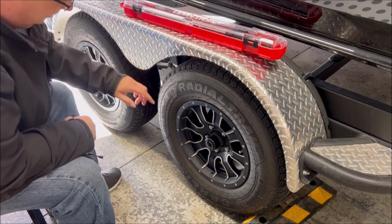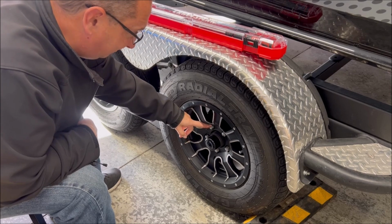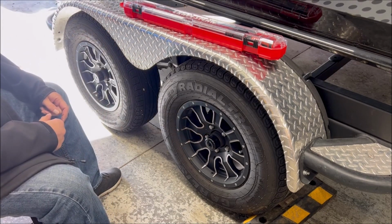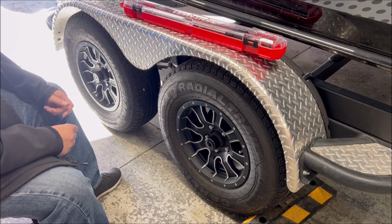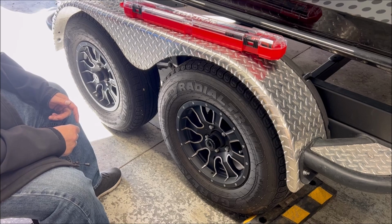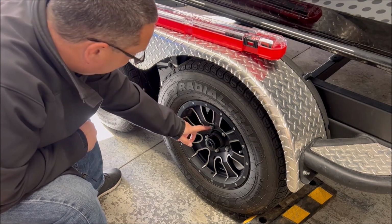Okay, lastly, for me, and I don't really recommend it anywhere, I go through once a season, maybe once every other season, you can get away with it, depending on how much you travel. I will go through and crack all of those lugs, and I'll take them off, either put a little anti-seize on the stud or just some white lithium grease, and put them back on. Why would I do this? Well, funny you ask. Some years ago, I was traveling with a family member's boat, and they hadn't done that in many, many years, and we had an unfortunate blowout on the highway, and I couldn't get the lugs off, and I was cracking the studs off, right? So I ended up going home with just two studs, which I don't recommend, getting home really, really cautiously, because, you know, we didn't check these.